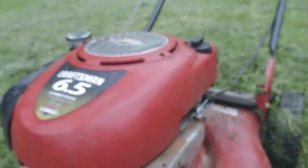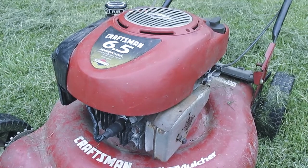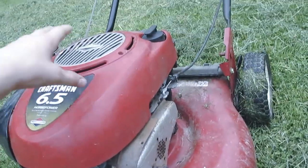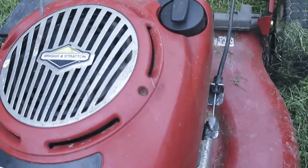Oh yeah, if you have a bad back or something, I saw it on this one YouTube channel called Project Farm. You can take these top covers off 100% completely. And whenever you do that, you can access the top crankshaft. There's a bolt up here, actually, in like a little can. Take that off, and you can turn the engine over with a drill. You don't really want to use an impact gun because it's going to loosen that bolt, and then your engine's going to come apart. Use something that isn't super powerful that will break that bolt.